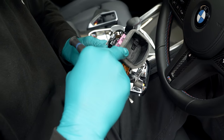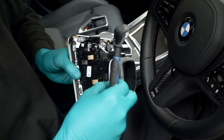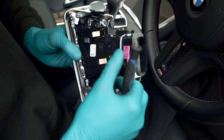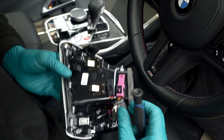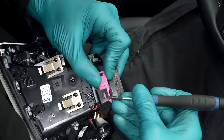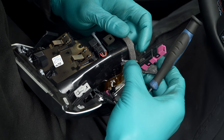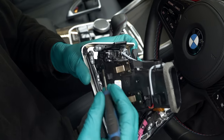With the assembly removed, you'll need to change over the vent from the old one onto the new Indiv one. To do that, you need to first remove this plug — peel back the felt tape if you've got it, revealing the tab. Be careful not to damage the wiring or the strip just underneath the tape. Use a very small flathead screwdriver, place it underneath the black tab, and wiggle the plug off.